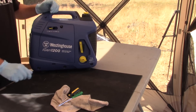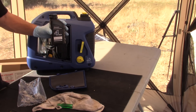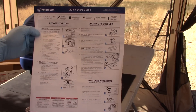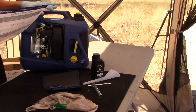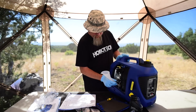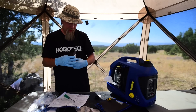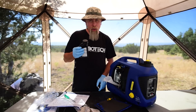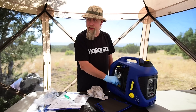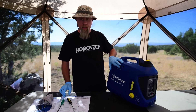Now we're going to take the cover off. Here we have the cheap four-stroke 10W30 oil. Here's the quick start guide. Step one is to add engine oil. We remove the oil fill plug dipstick, use the funnel, and add the supplied oil. It says on there 0.26 quarts — you add the entire thing. I like this funnel; it's very easy to fill up. Put the dipstick back in — it's got a nice little gasket on it. Then we're going to put it into choke position so we can start it.